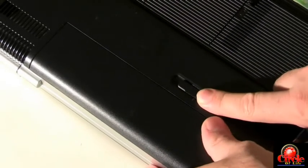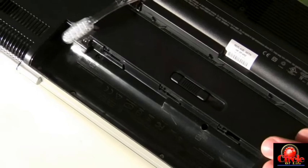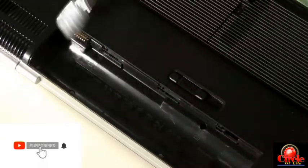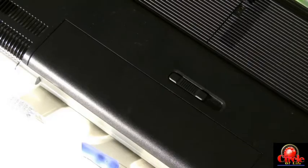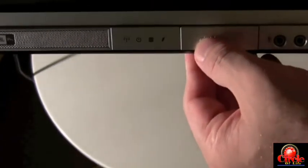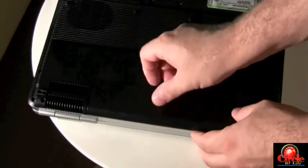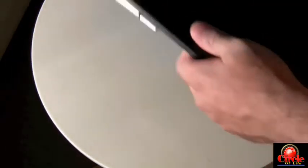Some other reasons a battery won't charge: the contacts between the battery and the motherboard may not be making a clean connection — maybe something spilled or there's a film covering the contacts. Take a dry toothbrush and scrub between the fins of the battery and where the motherboard connection is — preferably one that has not touched human teeth. Also, sometimes there's just some flukiness happening where if you take the battery out and put it back in, it might start charging. Try simple things first: reboot, power down, power back on, remove and reinsert the battery once or twice — that alone may fix the problem.